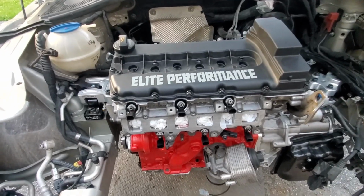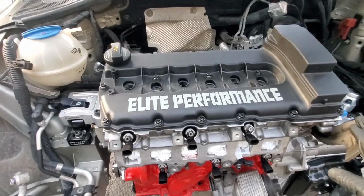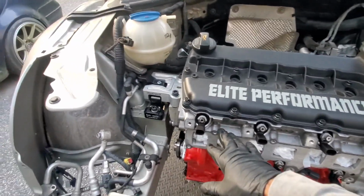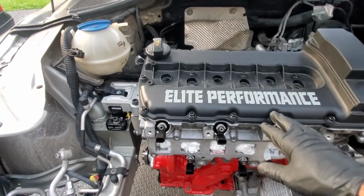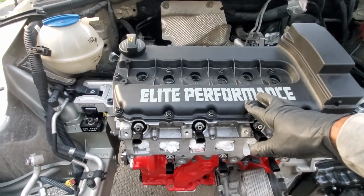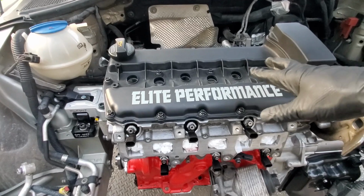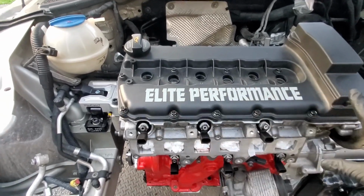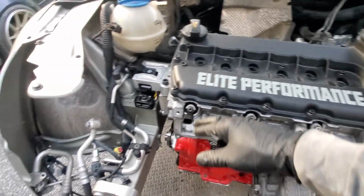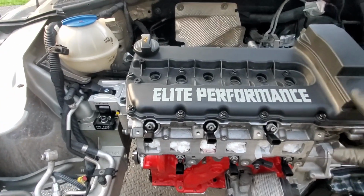If we have a small turbo, that turbo is making boost almost instantly and all the time. So therefore, you're constantly forcing air in here. So as far as having equal length runners, it is very important, but not as important on a forced induction car. I would suffice to say that's my opinion. And the reason for that is because if you have a manifold that's under pressure, the valves are seeing the same amount of pressure, whether this is staggered and this one is longer further back or not. Each valve is going to see the same amount of pressure.